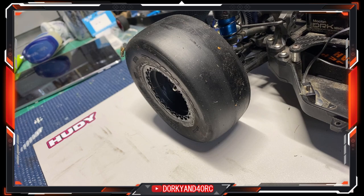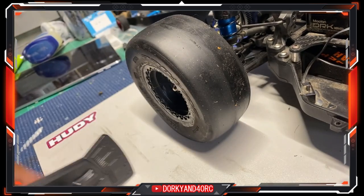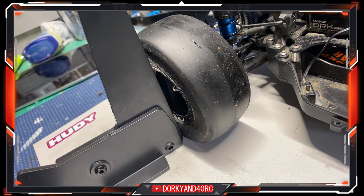No matter what camber angle you want, all you've got to do is just set your gauge to it right there, take it and put it up against your tires. You're going to want to spin your tire a little bit to make sure the bottom and top of the tire are both hitting the gauge at the same point. Real simple and easy to do — go around and do it on all four tires to whatever number you think is good. I'm going to go with zero on all of mine, because that is a good starting point I've had success with in the past.